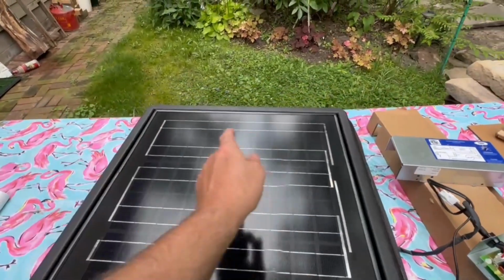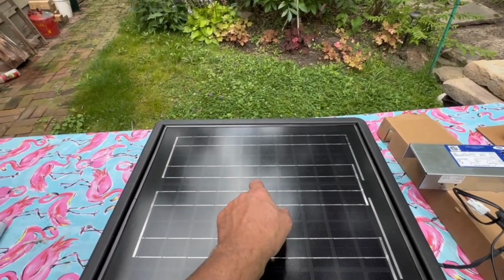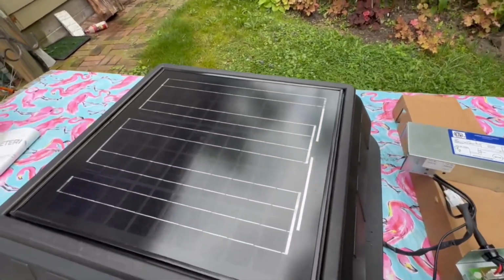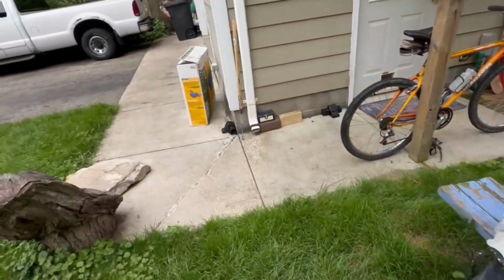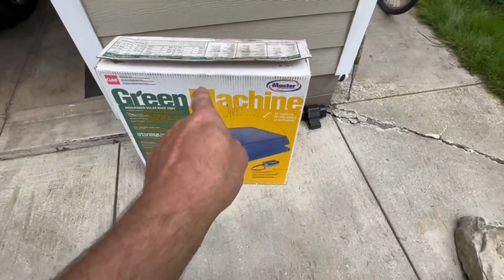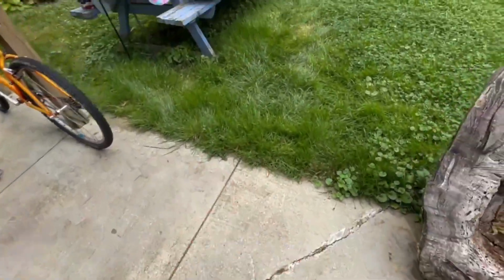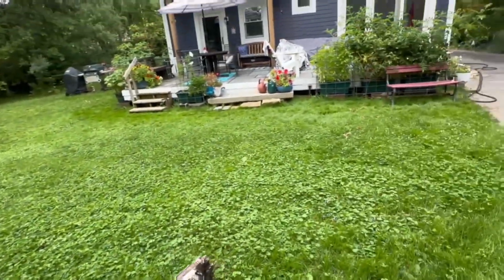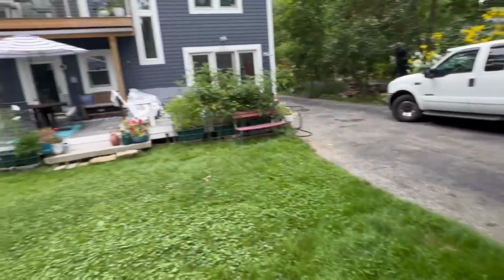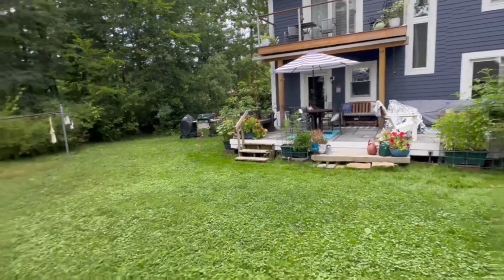So basically, I'm going to find the center between two rafters, drill a hole through it, similar to what we did last weekend with the roof vents. I got to measure down a certain amount. Then I come back and from the top, use this, which will cut as a template. And then I'll probably just use a jigsaw and go around there. If the rafters are 23 on center, so 23 inches across, then we make a round circle. If they're not, it's going to be more of an oval. I don't remember. I think it's 23.